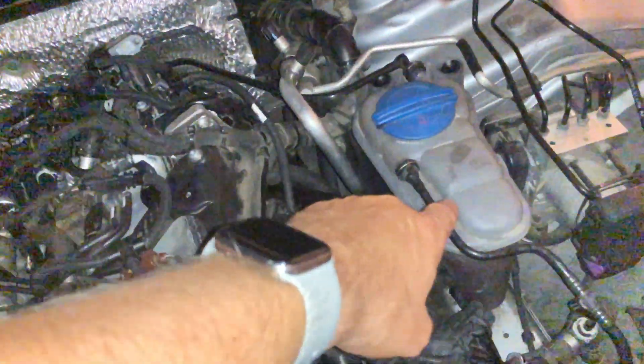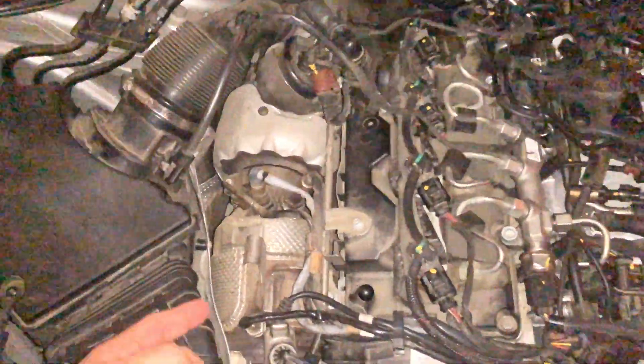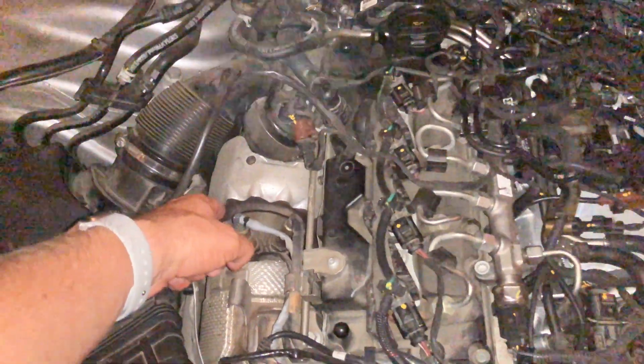There's another thing to check if you don't want to do the pressure test via the expansion tank and you don't find any internal leakage: go underneath the catalytic converter — there is a low-pressure EGR that can also cause issues and needs to be replaced. That's quite a bit of work: five to eight hours for the intake manifold, and seven to eight hours for the low-pressure EGR. I'm not a technician — I'm sharing what a very good Audi tech I know explained to me in detail.